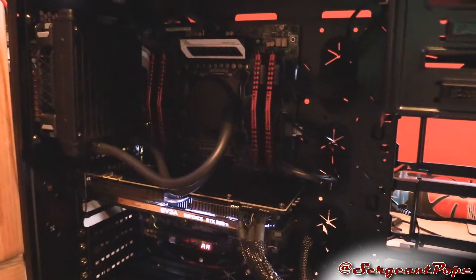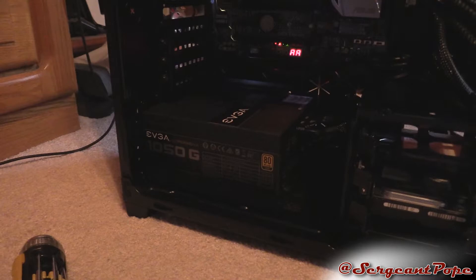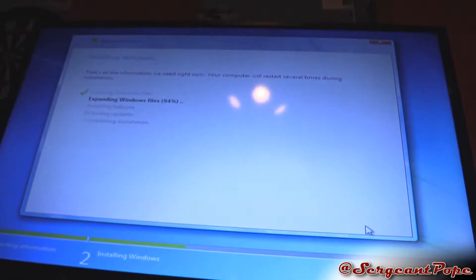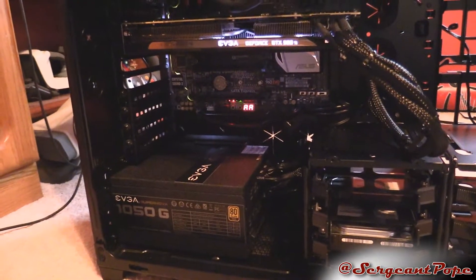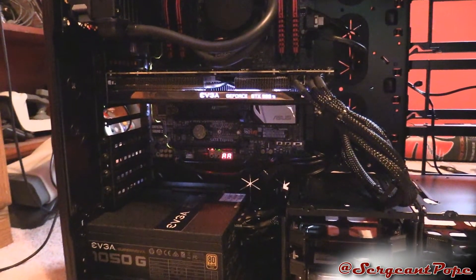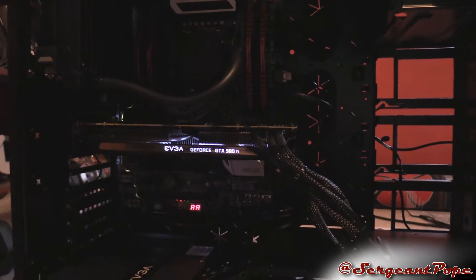And there she is running! So I've done quite a few upgrades. I was kind of waiting for the new power supply to come in, and that's it right there — working right now, which is awesome. The computer booted just fine with this new power supply, even using the same old cables, which of course weren't the issue — cables are almost never the issue. Got Windows installing right now. I'm installing Windows 7 Pro because that's what the owner likes. There was actually an issue with Windows 7: I'm installing it onto the Samsung 960 Evo NVMe SSD and Windows 7 apparently doesn't have NVMe drivers. But we finally figured it out — got the drivers onto the bootable drive and it finally worked, so that's awesome.